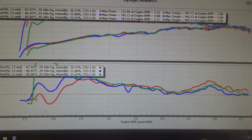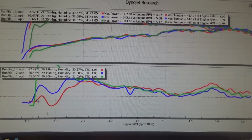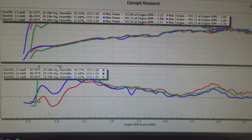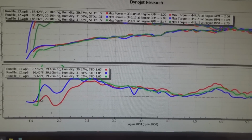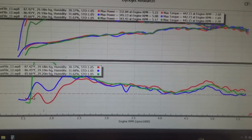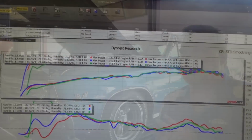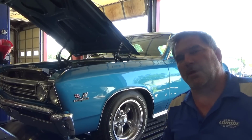Now the rears had a 3.5 power valve and an 82 jet in it, and I'm not sure where I'm going to have to go with that, but we'll figure that out here soon. But it's looking pretty good. I took extra spring out of the secondaries.